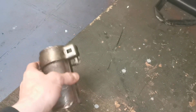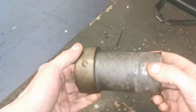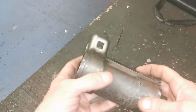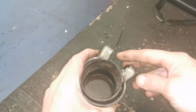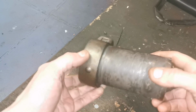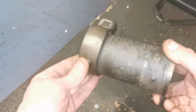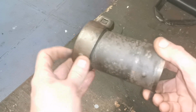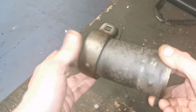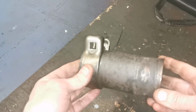But what I'm going to do then, because these clamps are a wee bit too big, and if it's too big it's not clamping down, so I tried that one that's on the car, and these two faces are coming in, they're touching. So that'll just loosen up with all the vibrations and going over bumps and getting shook about like crazy whenever you're driving along the road. And these cars are quite stiff, of course.